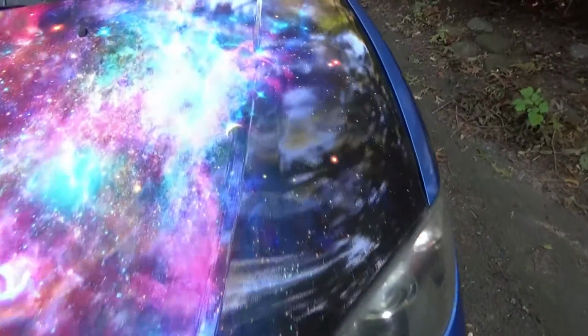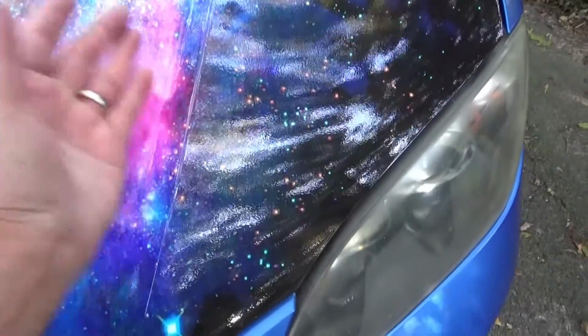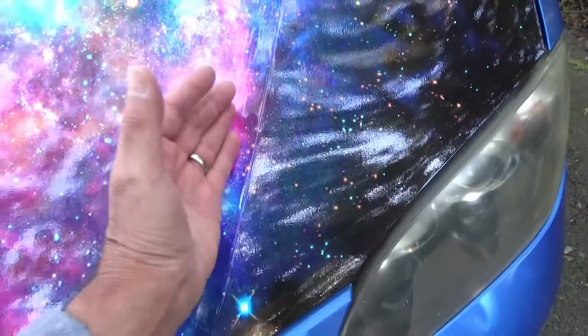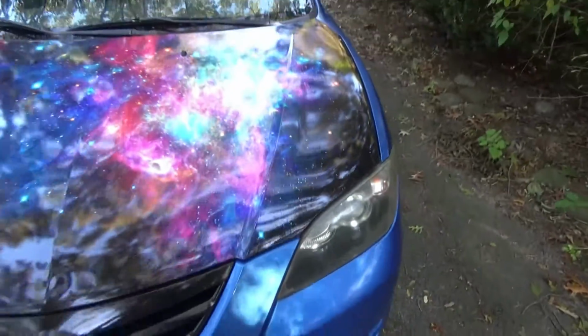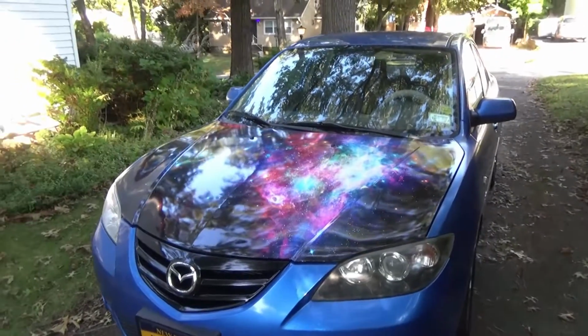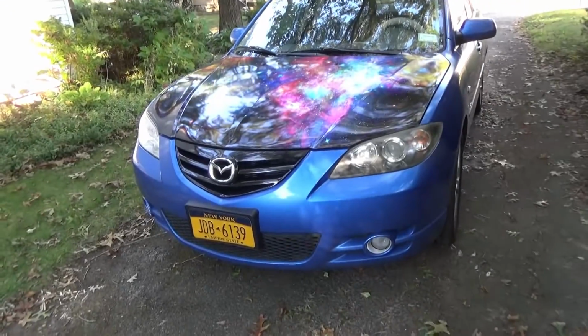You will solve the problem of any bubbling. And of course, doing this here in the valley, you just use the squeegee to make sure it follows the valley while you're putting it on and not stretching. That's what I learned on my last wrap. I had a problem in that after a year or two, it started coming apart, peeling.